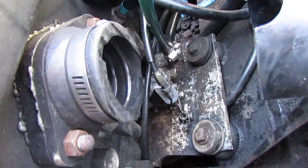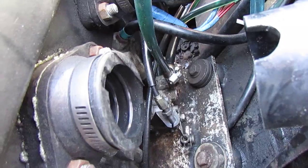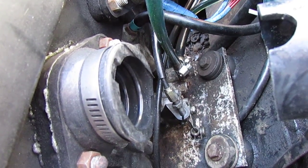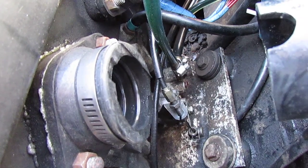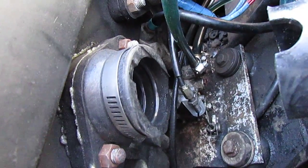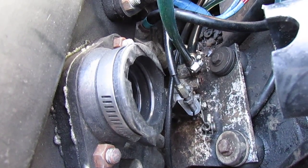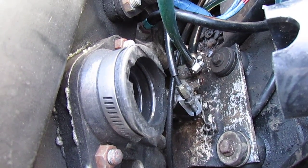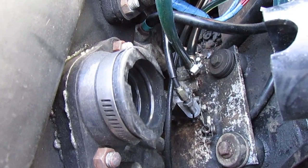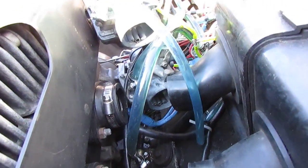If you don't know whether your injector pump works before you start a sled, first thing you want to do is mix up some pre-mix — 50 to 1, 40 to 1 — something a little heavy on the oil. This sled is an '86 Arctic Cat Cougar that I've been riding with no problems. It has 1,200 miles on it, so the internals of the engine are pretty good. I've rebuilt the carburetors a few times and learned the ins and outs of it.